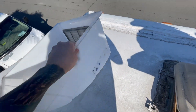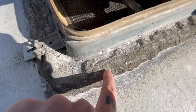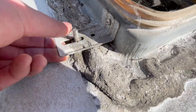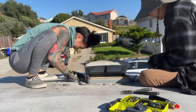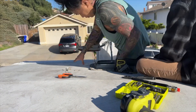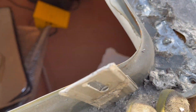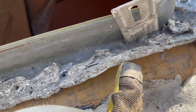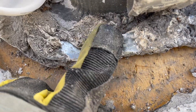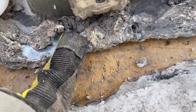So we just removed the hood from one of the vents — look at how old this is. We're gonna scrape all of this off right here. We thought that just loosening the glue around the edges was gonna help us. However, we discovered that there are screws every two inches into the base of the RV. We gotta go in and remove this tacky, nasty adhesive so we're able to see the screws and take them out.